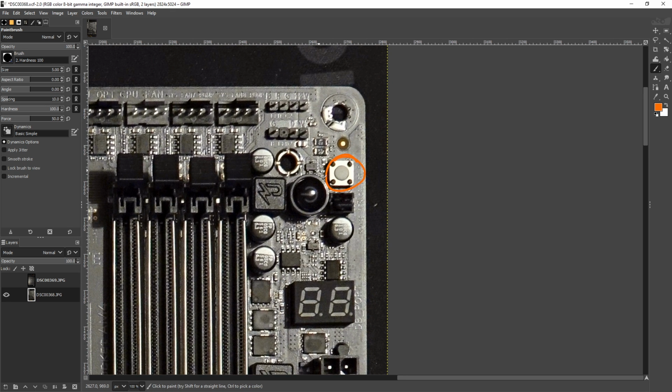There's a rebindable reset switch, which unfortunately isn't really that useful on X570. On Z590, Gigabyte has the same thing, where you have a rebindable reset switch, and you can rebind it to safe boot, go to BIOS, and it can also act as an LED on-off switch. Not entirely sure why you'd want an LED on-off switch. Go to BIOS, I guess, if you can't be bothered to just mash the delete key like a normal person.